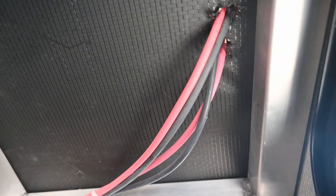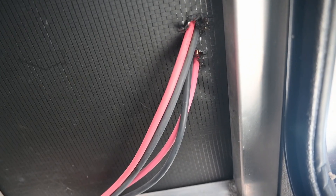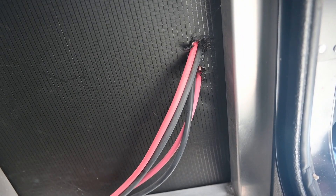I ran the wire through the floor, then drilled another hole through the front compartment firewall. When you do this, again make sure that you measure and know what's on each side before you drill. If you're passing the wire through wood only, you don't need to put any grommets or anything to protect it. But if you're putting it through metal, make sure that you put something there to protect the wire so it doesn't get cut by the metal. That should get you from the roof to your solar controllers — thanks for watching.